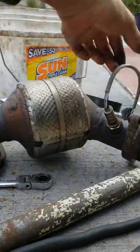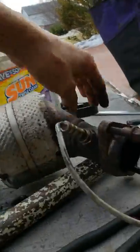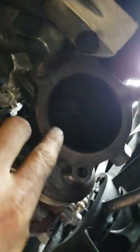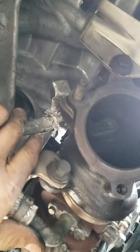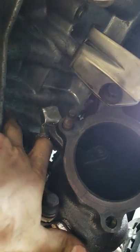You're gonna take out all the oxygen sensors connected to the catalytic converter and disconnect them. The one on the top can stay in place, but the one on the bottom you need to remove to access the bolt that is right there. Don't forget to spray your bolts — I had to heat them up too. Then you're gonna get to where the catalytic converter goes; here's the turbo and right above here is the crank position sensor.